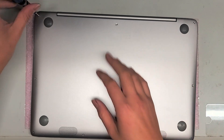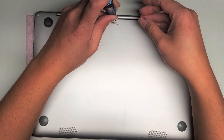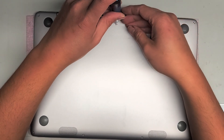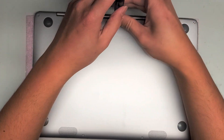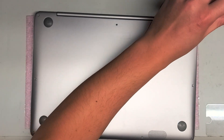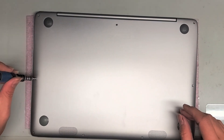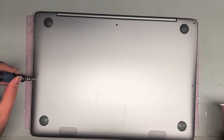I don't know if there's any screws hidden underneath the little rubber feet, hopefully not, but we're going to try and remove all these screws. There's three along the top, two along the sides, and four along the bottom. You want to keep the screws in order — they are different sizes, shapes, and lengths, and you don't want to get them all mixed up.